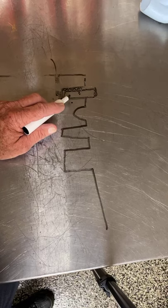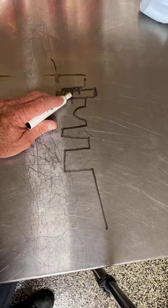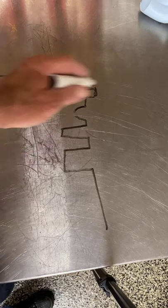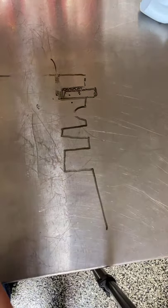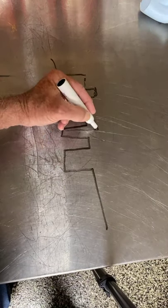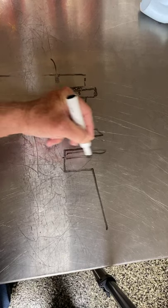high, a really nice straight smooth finish on the ring lands, and also Total Seal does a wonderful job diamond grinding the bottom of the rings and the top of the rings so that you have a really nice finish to keep that ring seal. Now the vacuum, the reason this works is you've got the second ring here, which is a scraper. And then you got the three-piece oil ring.